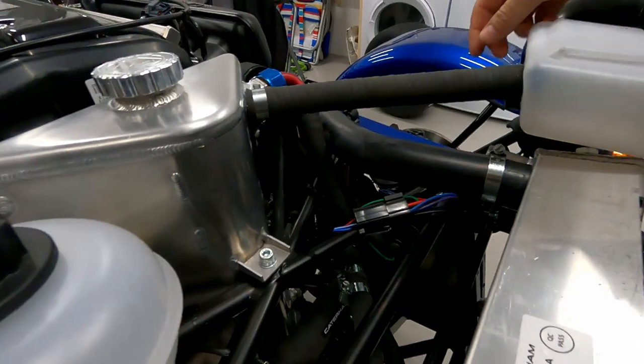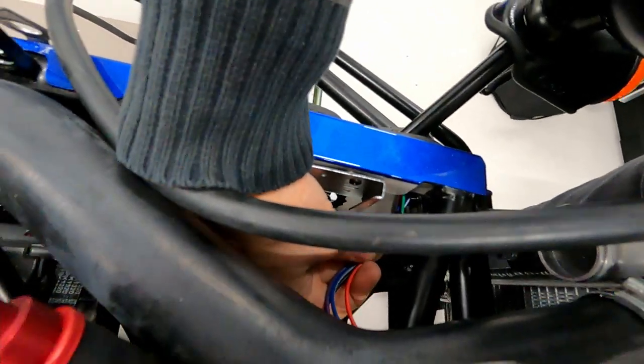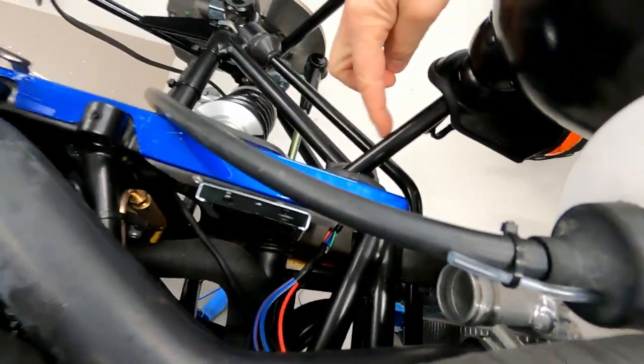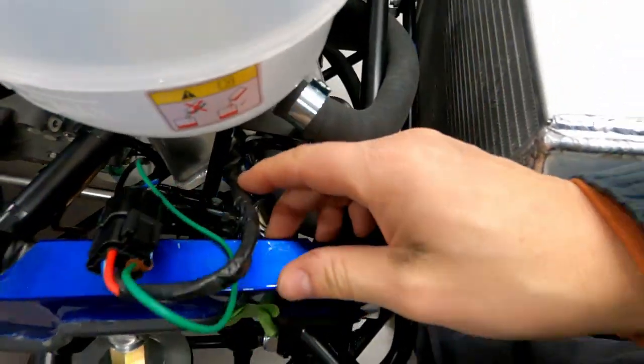One of my early jobs, not obviously done very well, is you can see there is a green wire that is coming from there. That is the green wire that connects to the indicator bulb, but I think it terminates here. I think that black tape there is where I basically sealed it off, so it's nowhere near enough length. So I've obviously got it mangled somewhere in the actual stalk. And on this side, it exits from my work into this loom, and I think it's somewhere in here. So I suspect it's there.